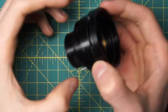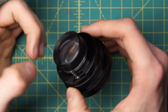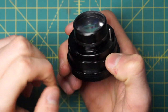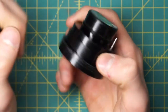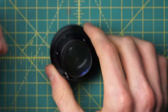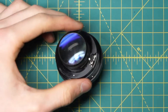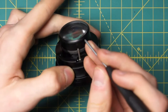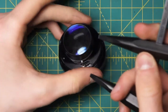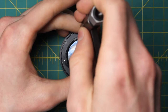The only real annoying thing about this lens is that to access the back of the diaphragm, you have to remove all the individual glass elements and access it through where they're sitting. You can't just unscrew a single piece on the back section. During this whole disassembly, you're pretty much guaranteed to get fingerprints all over the glass, which makes putting it back together interesting as well.